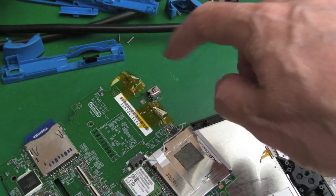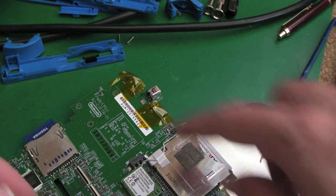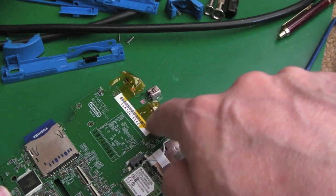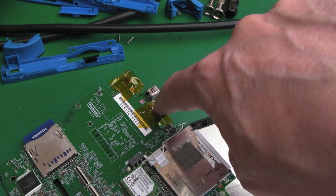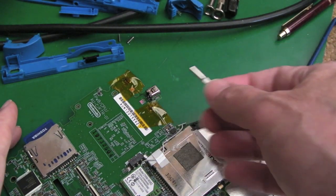But you could stick foil around that, aluminium kitchen foil, the sort of thing you use for sticking in a tray before you put things in your oven. You could stick some foil around there as well. But Kapton tape and foil, those are the sorts of things you need to do just to isolate these parts. And now we can just get the hot air on here and focus on that. It's only going to take a minute or two, I would think, to remove that.